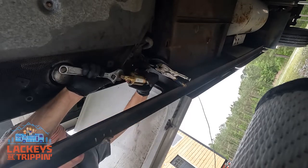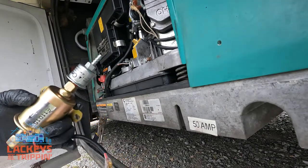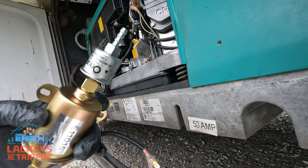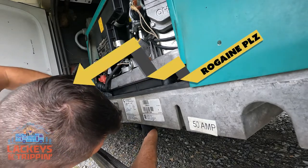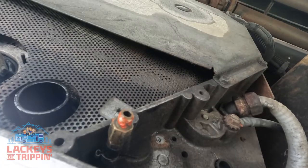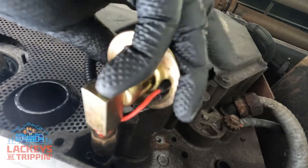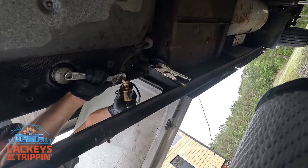You should have enough room in there to work if your RV is set up like mine. I've got the fuel filter screwed into the fuel pump. I had to put a little bit of red RTV gasket maker in there to create a seal, because the factory seal was compromised when I put it on the old pump. I also put some RTV on the fuel line connection. Don't overuse it, and make sure you don't get RTV in the hole — otherwise you'll have RTV in your carburetor, which is not going to do good things to your fuel system.